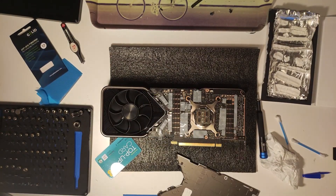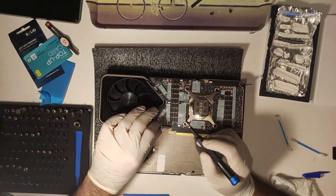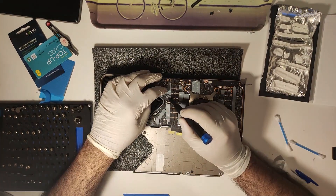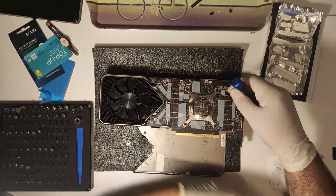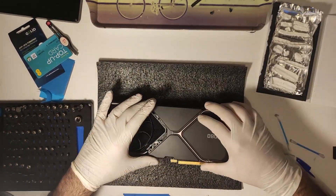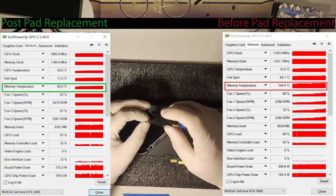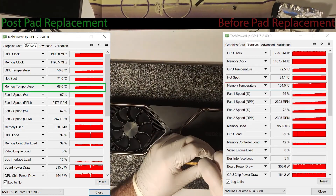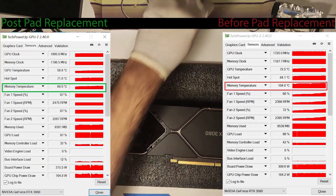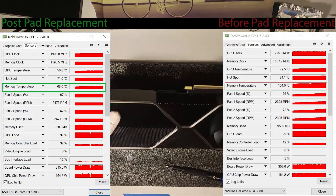Put back all the screws and their caps and you are 100% done — pat yourself on the back for a job well done. This has been a very long video and I hope it has given you the confidence to start this mini project, or abandon the idea altogether depending on your inclination. This made a night and day difference for me — over 25C improvement on the memory is a giant margin that has alleviated a lot of pain while gaming. It has eliminated the need for the fans to go into panic mode every couple of minutes to keep the memory modules from self-immolating and ruining my concentration. Just look at these two screenshots taken in the exact same conditions a couple of hours apart.